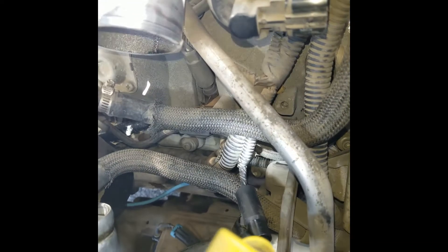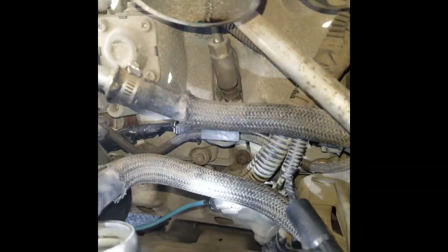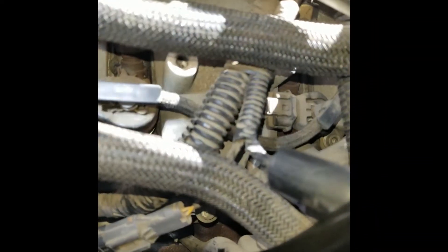As it turns out, it is cylinder number one. It's interesting because the OBD2 sensor didn't identify cylinder number one, but when I jiggled cylinder one — it was the one I haven't replaced — it triggered the fault. It's buried down in here. There it is — you can see it down in there. Yeah, right in there. That's got to come off and get replaced. I jiggled it; it's been there since the original and that's causing all the faults and causing this intermittent problem.